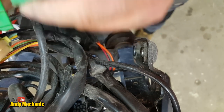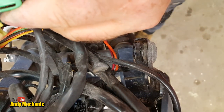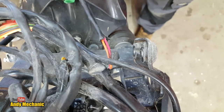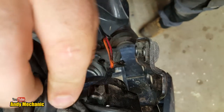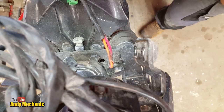It does. Okay, so there is definitely an internal fault. Yeah, ignition's definitely turned off. So we definitely have a fault with the ignition, with the barrel itself, with the switch gear. So we're going to see if we can extract the switch gear with the ignition barrel in place, because it's got those Allen bolts? Let's have a little look, see if we can get the old camera in there. What we're looking at, just a pointy screwdriver. That there is one of the retaining bolts, and it looks like an Allen head, a cap head. Oh no, it's round. It is a safety security bolt thing.